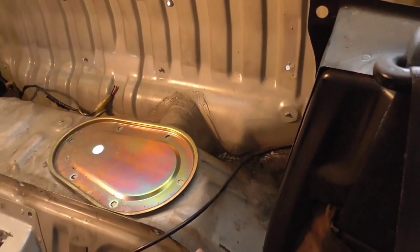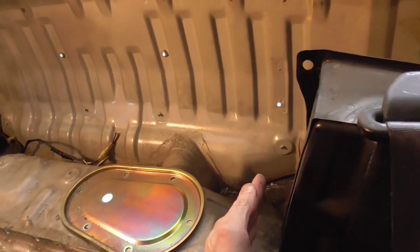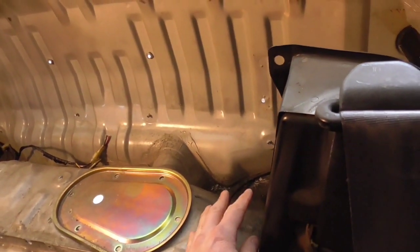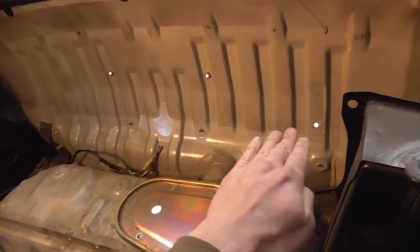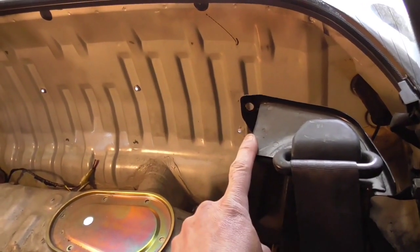We'll probably bring our wires in down below here, and then have a bus bar system right here. So our charger wires will come in, our main wire, and then our pack wires will all kind of converge right here. And we're going to put 3 more modules of 5 cells each, and that's going to come up to about 6 inches or so. So it's still going to be down below this peak part right here.